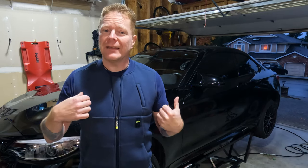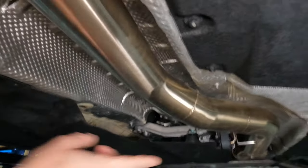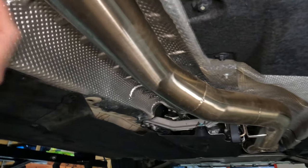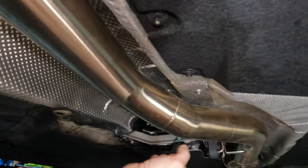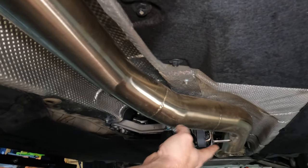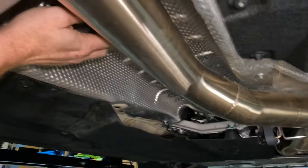Car's up in the air. We're going to slide underneath, remove a couple of body panels, and get this installed. Here we are underneath the car, looking towards the front — that's the motor end. Here's my mid-pipe. The piece you're looking for is directly behind the central heat shield. Usually where the bend in your mid-pipe is — and if you've got the OEM pipe it'll look a little different — you can see the mid-body hanger right there in gray, and it's behind this heat shield right here.